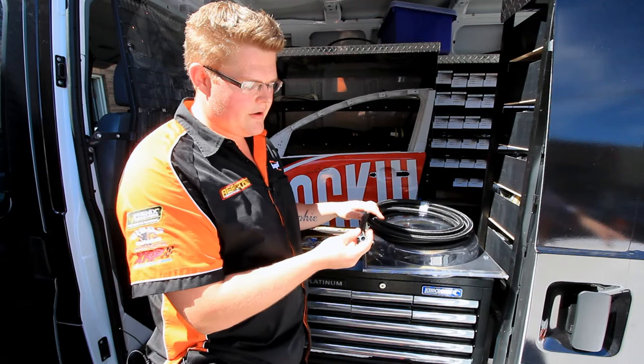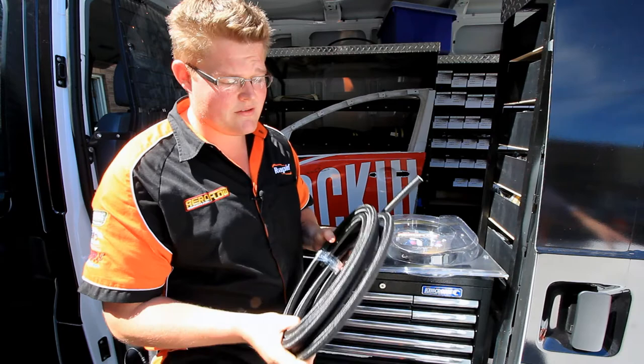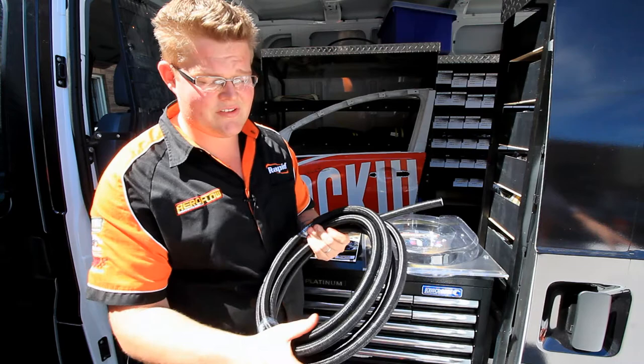I just want to show you the new 250 series braided hose from Aeroflow. It's the Teflon line stuff, so it's the same as the 200 series with the stainless steel braid on the outside. But in a world first, Aeroflow have come up with this black braided nylon cover that goes over the top of it. So it's the same pressure rating, same compatibility with ethanol, methanol and unleaded fuels, compatible with Teflon, and uses the same fittings as the 200 series as well. If anyone wants a more standard look or a nice stealth look, you've got to have this stuff. It's amazing hose.